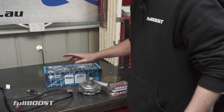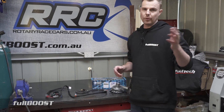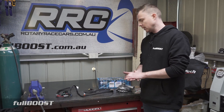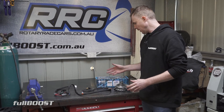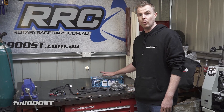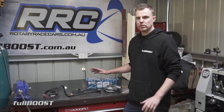We had a lower quality Chinese thermo fan on Project Redline originally. I found the water temps were creeping up to a hundred degrees, which is insane for a race car that doesn't run that long. We could see the radiator hoses ballooning out, and I couldn't work out if there was a mechanical issue or what it was. I changed the thermo fan to a Davies Craig one, and now the water temps are stable at around 80 degrees. Just that one change to a quality component, instead of trying to cheap out on a lesser quality brand, saved us no end of trouble.